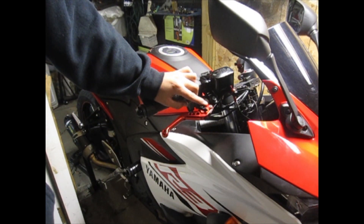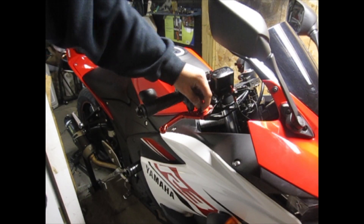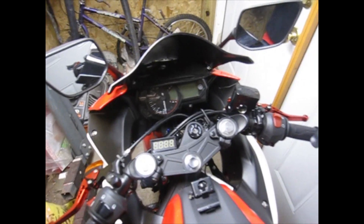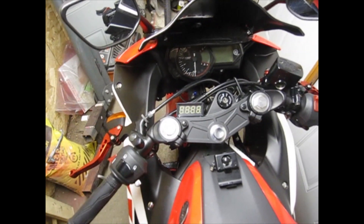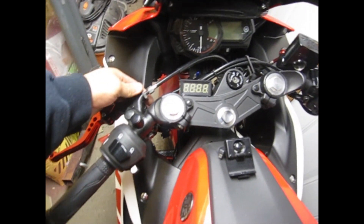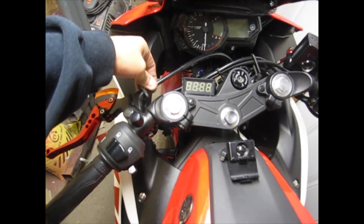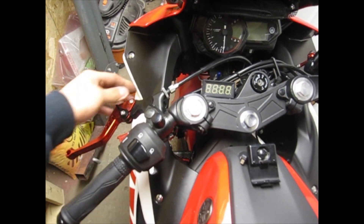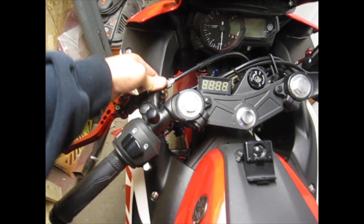You have six adjustments here. Right now I have it set to three. You could adjust it to however you feel — if you want the lever closer, put it to number one and the lever is closer to the hand grip. That concludes our installation of the shorty levers. If you ever need to adjust the tension on your clutch side, just loosen this nut here and then turn it clockwise to make it feel more loose or counter-clockwise to have the lever feel more tight. Once you find the desired position, tighten this nut until it's locked in place and you're all set.